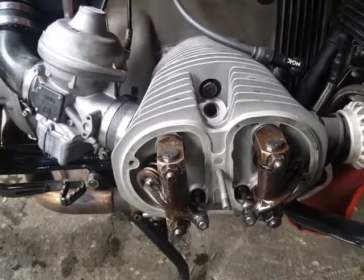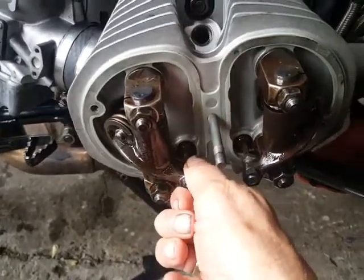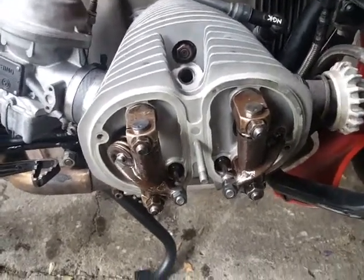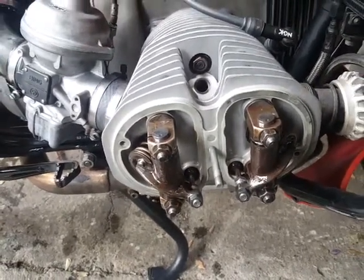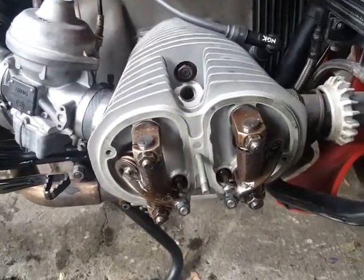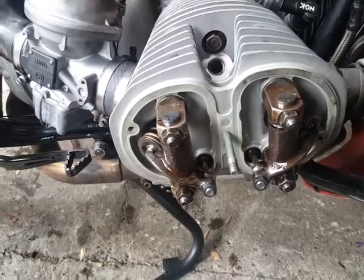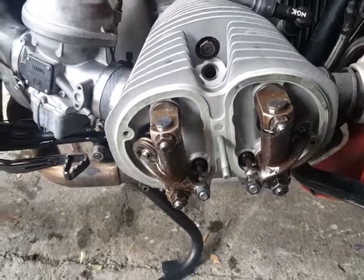So I got here this morning, let it all cool down, dropped the oil out, just checked for all things like end float, tappet clearances, things closing up. All the heads are pretty much brand new. The original casting is still there, but everything else is fairly well new. Even the rocker shafts, needle rollers, and all those things have been changed. And it's all looking great. Heads are settled a bit, so they needed a retorque. Tappets needed a reset. Check the compressions; they're all well and truly up over 150, around that range. Nothing to whinge about at all, really.